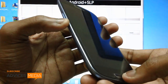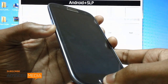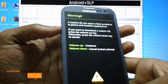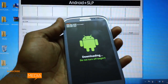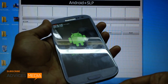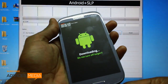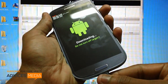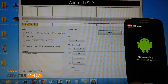Press the volume down key followed by the menu button, and then press the power button simultaneously. Then all you need to do is press the volume up key to enter the device into download mode. Once Odin is open on your computer and the download mode is entered on your phone, just connect your USB cable — the other end should be connected to your laptop or PC.